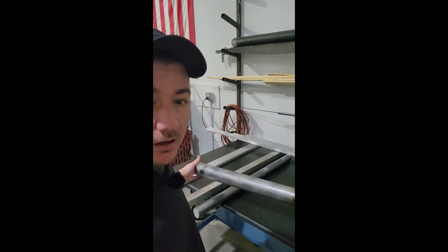Here's the Roads Fabrication rear end — be prepared for the tubes not to be straight especially if you order without ends. The welds aren't pretty but it holds. I then bought a 10-point cage off Facebook for $500 — used, never installed. It's chromoly, pre-notched to the point where one end of the straight pipes is pre-notched, with two bends — it was a halo bar kit. We're not running a halo bar; in 25.5 spec you can run one but your head has to be behind the main hoop per their specification.